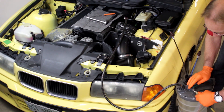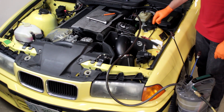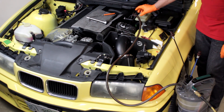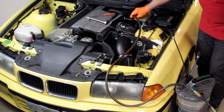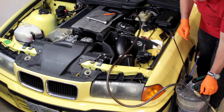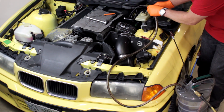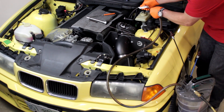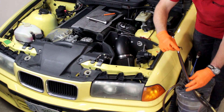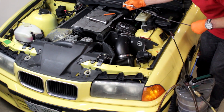Before the oil is fully extracted, we'll show you how the air compressor line connects to operate the siphon for the extractor. Connect the air line to the quick disconnect nipple and open the siphon valve — the unit will now create its own vacuum. When the extractor nozzle starts to suck air, move the nozzle around to assure full oil extraction. With the oil extraction complete, close the siphon valve. Pull the vacuum brake valve to release any remaining vacuum in the extractor. Disconnect the vacuum hose from the extractor nozzle and store it on the extractor unit. Remove the extractor nozzle and store it in the nozzle storage tube.